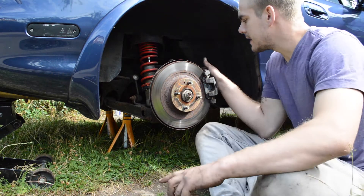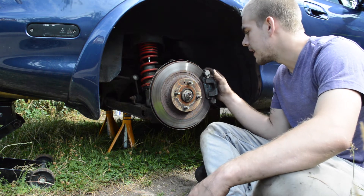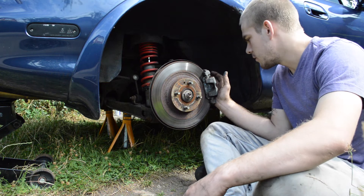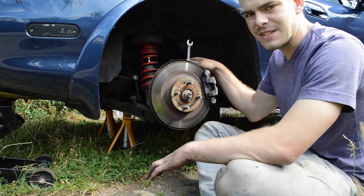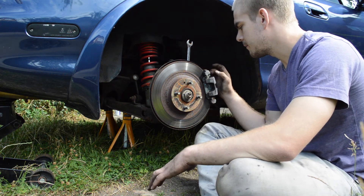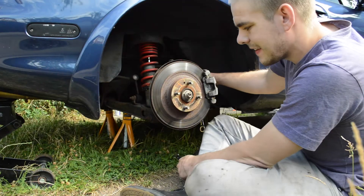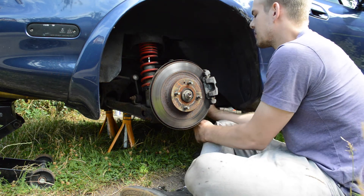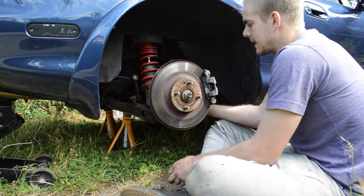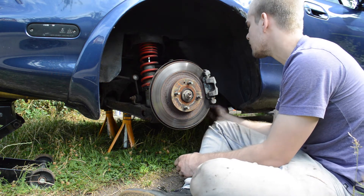I'll show you the rear brakes - they're a little bit different. You've got the handbrake cable on these calipers. These calipers are different to the front ones because they don't bolt onto carriers - it's on a slider inside, so it all comes off as one unit and then you can take the carrier out from there. These are a bit of a pain to get the pads in and situated. Front ones are nice and easy but these are always a bit of a pig. Crack that nut off on the holder - slide it out of the little bracket, take this T-piece out of the lever arm, and leave that hanging on the arm there.